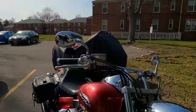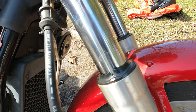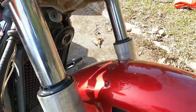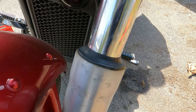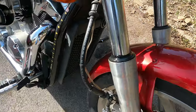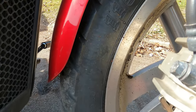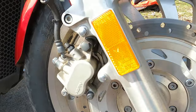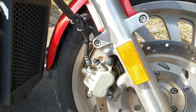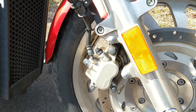As I left off last time, last year — if you took a look — I had a short little video of my catastrophic failure of this fork seal. I thought it was water at first; I left my bike out in the rain. I knew it had a little split in it, it didn't look the greatest — even this one had cracks. But now it's pretty clear — this year it was dripping all down, got all over the brakes. You can see a lot of crud on there, and it got the brake pads all jacked up. They're soaked with oil — they're useless.